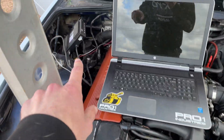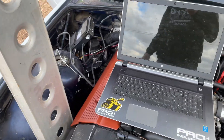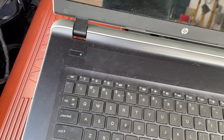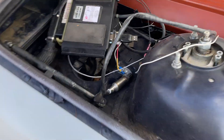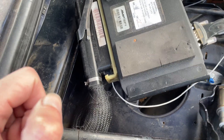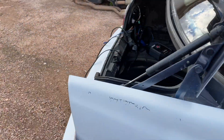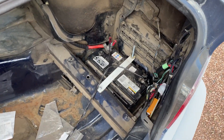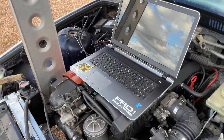I changed the plans. Tried to hook my laptop up to this Megasquirt - all the lights turned on but I cannot get my laptop to communicate with it. Tried all my bag of tricks. The ECU might be dead - it has a date stamp of 11/21 but I don't know what the issue is. He's got a stock ECU, so I'm going to try to do an EWS delete and see if the car will just run off stock ECU. I've got the battery tender hooked up because last time I did an EWS delete, I almost bricked the ECU because the battery was bad.